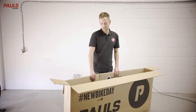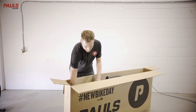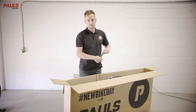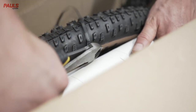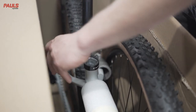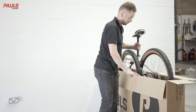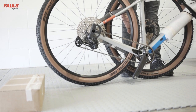In the box you'll see the bike and a box of user manuals. This will be down by the rear wheel. Take this out first and put it to one side. Then it helps to take the seat post off of the rear wheel — use a pair of side cutters to cut the zip tie and then install the seat post in the bike. You can then lift the bike out of the box and place it carefully on a soft surface such as a blanket or a carpet.